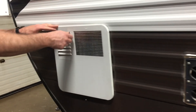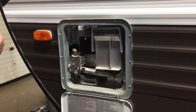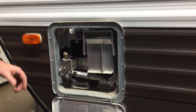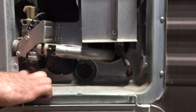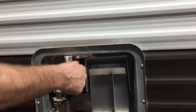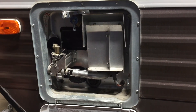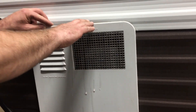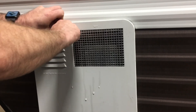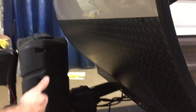There's the exhaust for your furnace, and here's your hot water tank. The hot water tank runs on both gas and electric. If you're running electric at your trailer, there's a switch here — off or on — for the electric element. Once you know your tank is full, flip the pressure release valve to confirm you have water, then turn the electric switch on so you don't burn out the element. Inside is the control or switch for the propane. You can use both at the same time — so if you're having a shower and want faster recovery, you can use propane for quicker recovery and a couple of minutes longer shower.